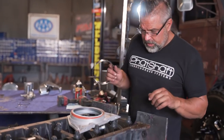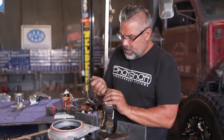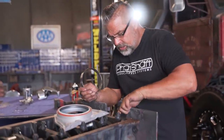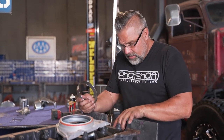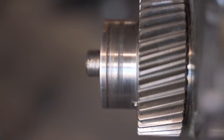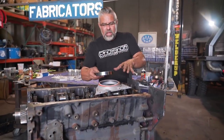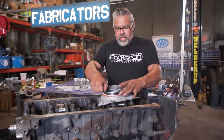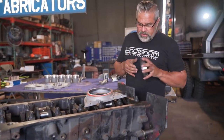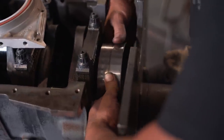Now what we're gonna do is try to put the speedy sleeve on the rear main of the crankshaft. The problem is, on a lot of these crankshafts, over years of running they get a little groove put in them — and you can probably see it on this one, see the little grooves right there. Typically there's a tool that applies this all at once, but I pulled this out because I don't have that tool, so we're gonna see if I can make it work.